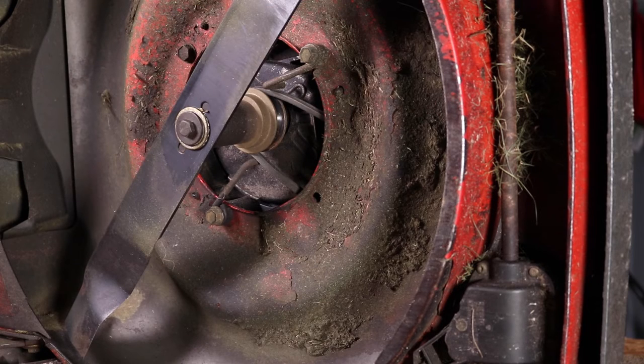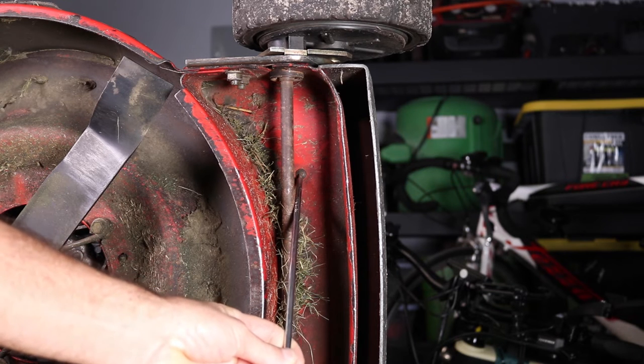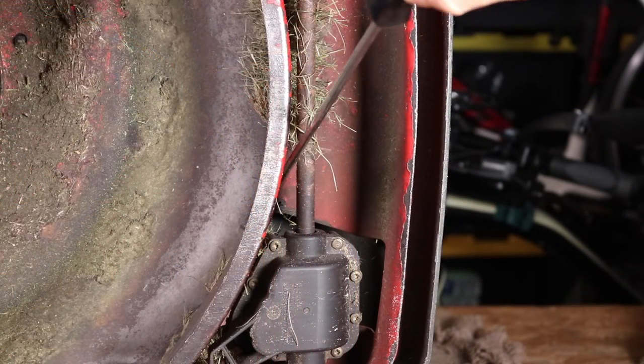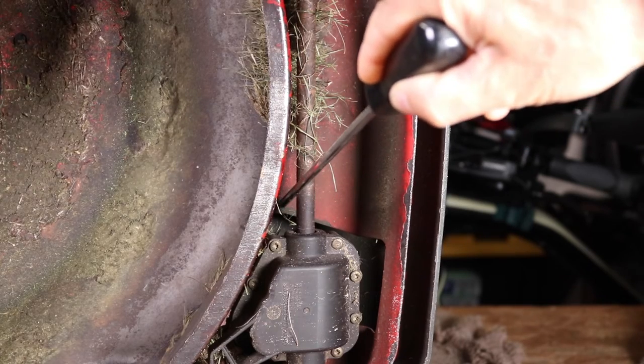What we need to do is take that cover off. There are two screws that hold it on from underneath. To get that plastic cover off, it's only two bolts down here — we have one right here. It's a T10, a Torx 10, and we have another one down here just above the transmission, and it's a Torx 10 as well.